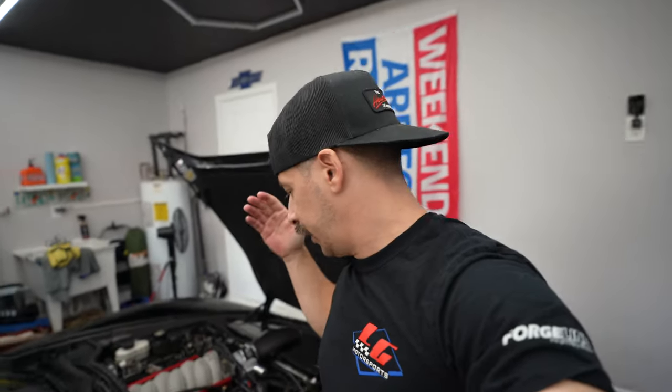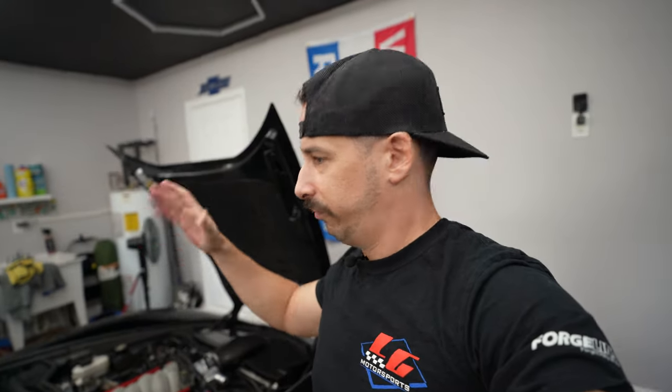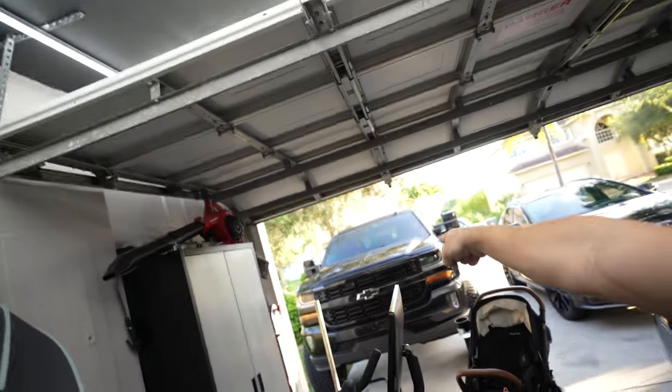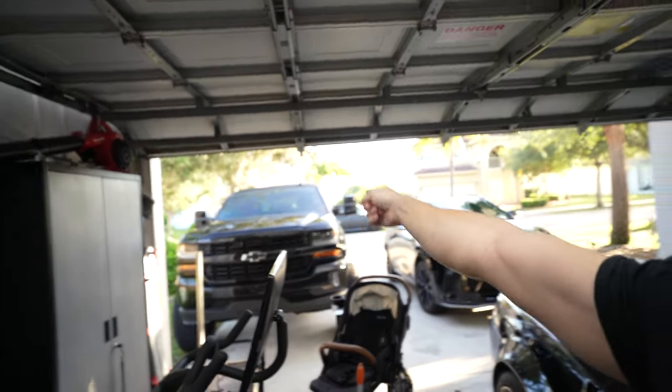This car is going to be track-driven. I want to make sure it's happy and that I'm not doing stuff that could potentially cause harm to this motor. When I was on track my bumper was getting coated in black — obviously my car is black, but you could definitely tell it was being coated in soot from oil being pushed through. When talking to Haltech, they assumed it's due to the system not venting properly, not using intake pressure to help relieve the crankcase pressure.